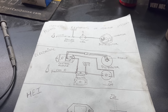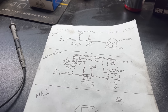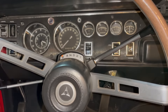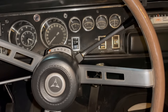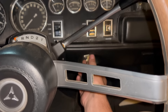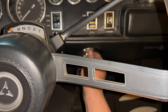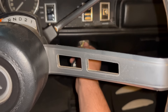If that's the symptom you're experiencing with your classic Chrysler, your resistor's bad — or it's unplugged, or you have a wiring problem, but probably the resistor's bad. If it doesn't fire and then die just like that, it's not a failed ballast resistor; it's something else. If you need help figuring out what that something else is, go check out my classic Chrysler ignition systems video, where I detail all of the diagnostic steps you need to go through.